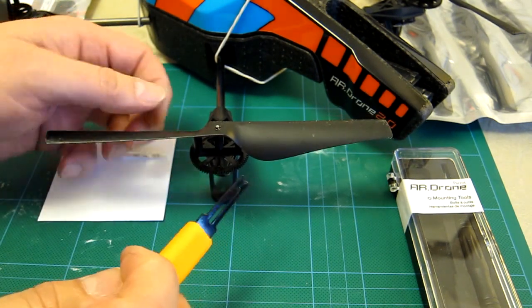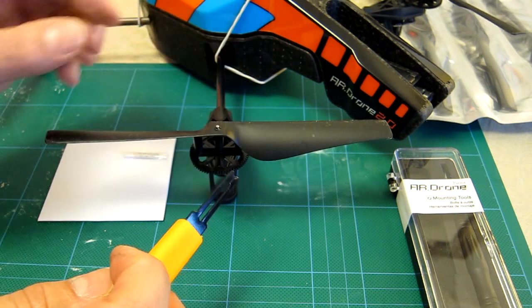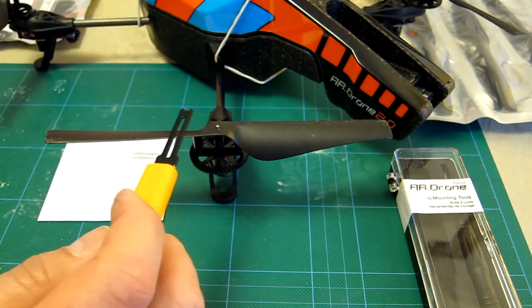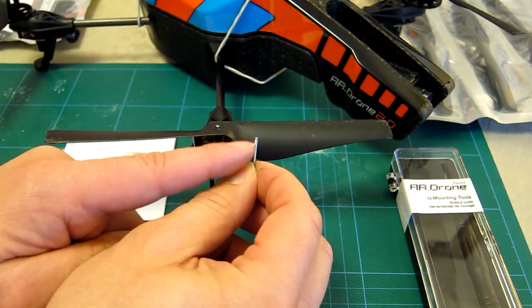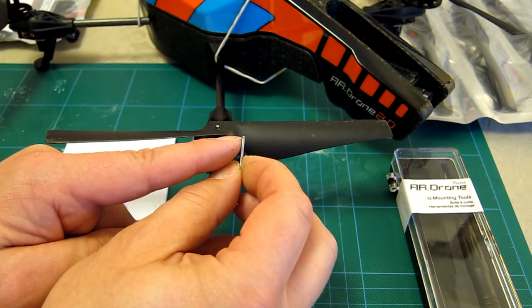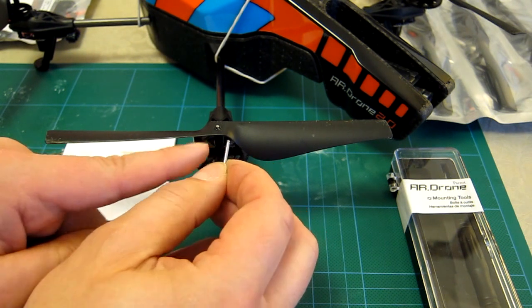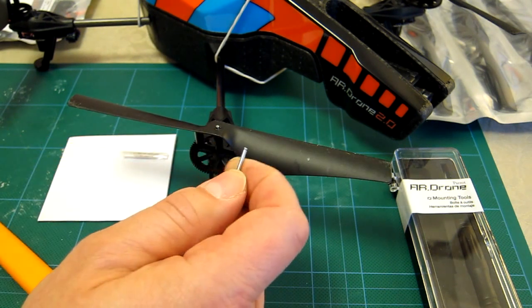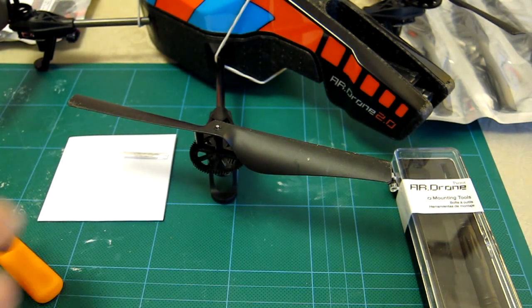If it hasn't clicked on you probably haven't done it right. That's absolutely in place. I'm going to do a close inspection to guarantee the clip is exactly where it should be. Running my nail around the recess at the very end — you want to make sure that C-clip is 100% seated on both sides, all three contact points in that ridge. Job done.